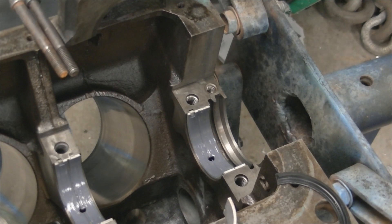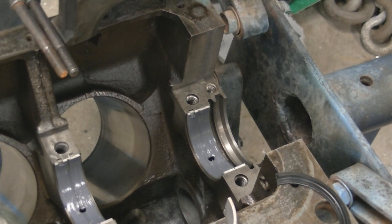What I am going to show you is the rear main seal. I talked with my engine builder and I am getting rid of the rope seal that originally came in this engine. We are going to be installing the new high-tech seal — gets rid of the rope.